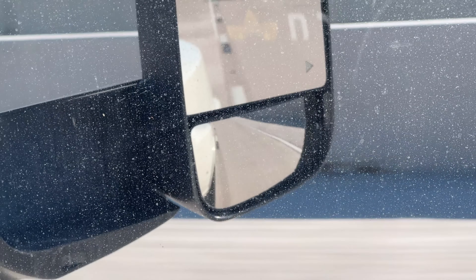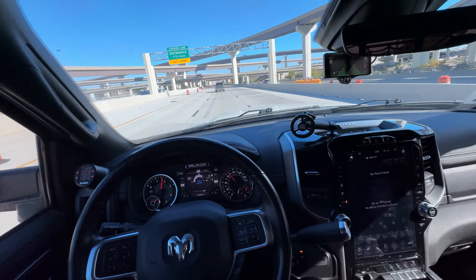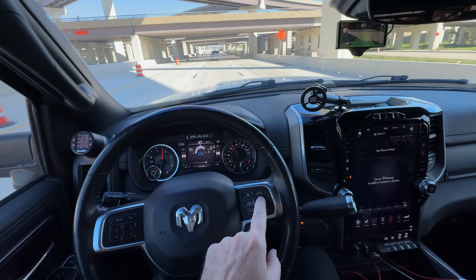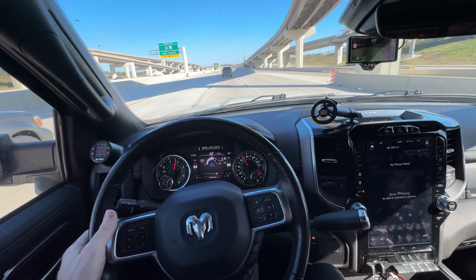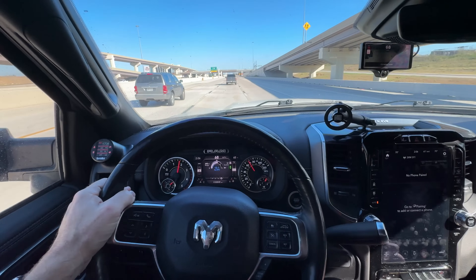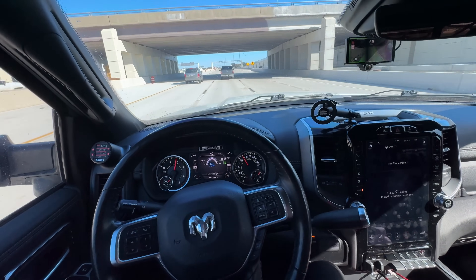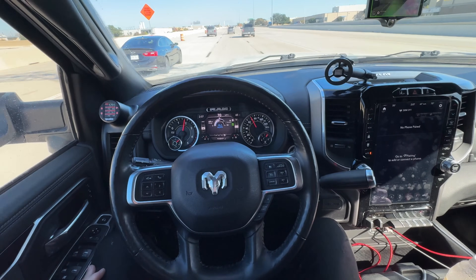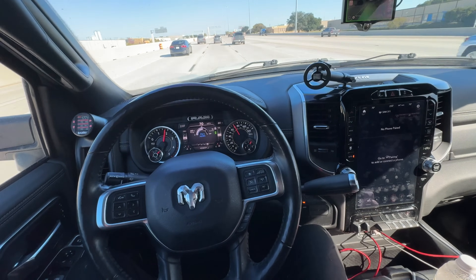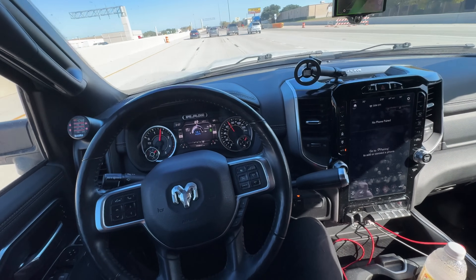I've noticed the screen seems to cheat a bit to the right. I'm going at a reasonable speed but let me speed up to about 85. It'll only go as fast as the car in front of me, of course. I want to demonstrate this oscillation — you see it? I think it's because the truck bounces around. The heavy duties bounce around when they don't have a load. When I had the trailer on with ten or fifteen thousand pounds, it doesn't do that so much.